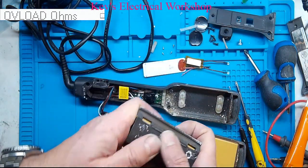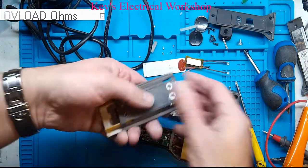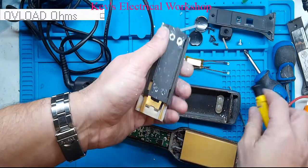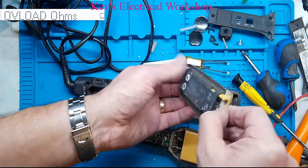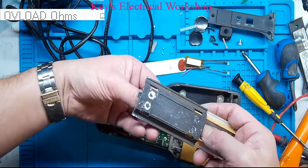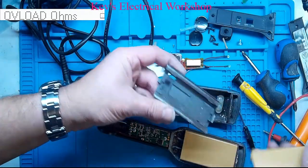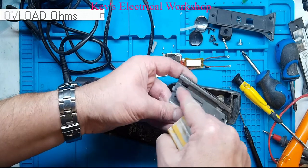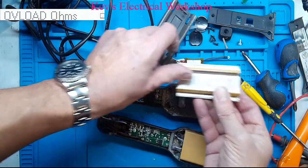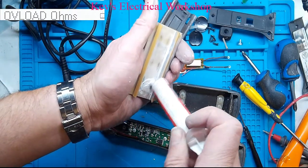Pull the thermal fuse out — now it's just the clip. Normally I've got a hole here where I can push it down a bit just to release it. There, she's released, so it should just beautifully slide out. And you can see a nice little bang mark where it went. Clean this off and put some more thermal compound on, ready for the new heater.